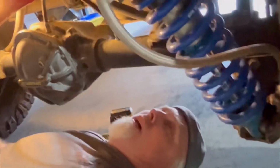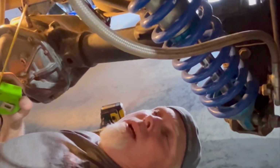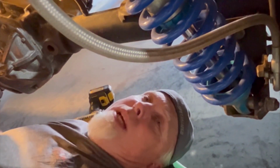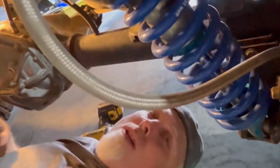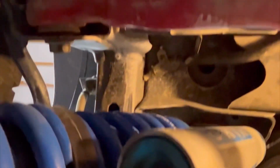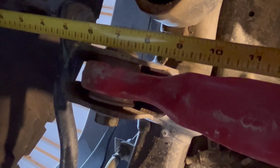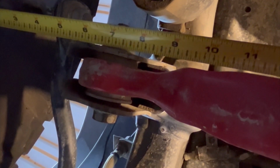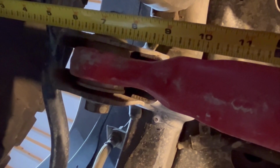All right, so here's what's gonna happen. So the strings are run, and I know that I'm off almost 7/8 of an inch. So I need to do half of that distance, which is 3/8, and then it'll be square. If I adjust this and go back up in there, then I gotta redo the strings again. So really all I need to do is take a reference point. Trying to figure out where to do it is what I'm going to do. Here, sorry about the camera. I'm gonna get a measurement off the rim to the track bar, which on center is exactly 7 inches. So from the inside of the rim right there in the bead, I've got 7 inches. I'm gonna move that over 3/8, and that's good enough. That's how we're gonna do this. I've already got the bolts loose, so I'll move this over here in a second.